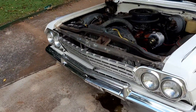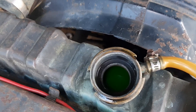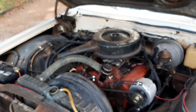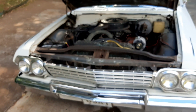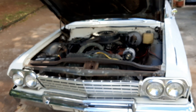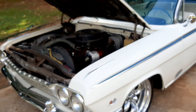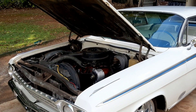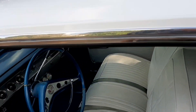I dipped out some of the antifreeze just to see if it would move — I know you can't see it but it is moving, so the thermostat's open and the radiator doesn't leak. I'm wondering if you have a '62 Impala — this is a 283 with a Powerglide — what does yours normally run? I thought maybe between 180 and 200. I don't want to mess this motor up; I had it rebuilt in like 1985, it's just a stock 283 with a Powerglide transmission.